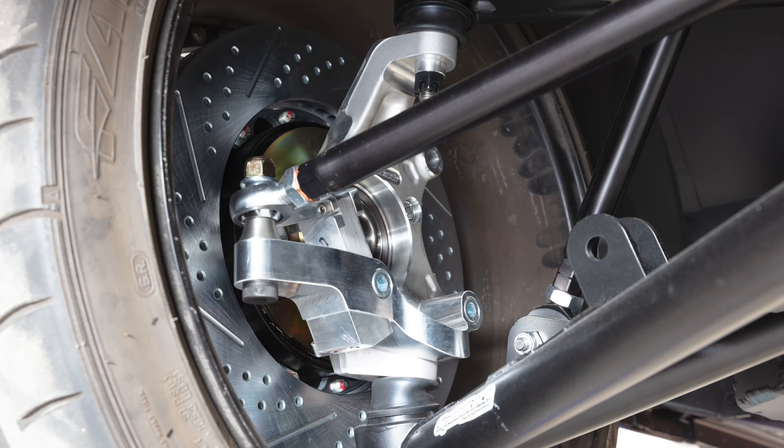Our forged spindle uses a C7 hub, and the axles are all 35-spline. To the best of my knowledge, we're the only ones that use a 934 CV, which is the big beefy CV. The standard axle package comes with a Dutchman aluminum center, 35-spline stub axles in the center, and 33-spline stub axles in the hub to fit the Corvette hub. That package is good to around 1,200 horsepower and should be pretty safe. There's also an option for upgraded 300M axles and billet 934 CVs — Dutchman tells us those will handle 1,800 horsepower, no problem.